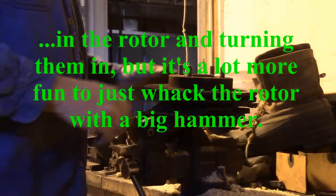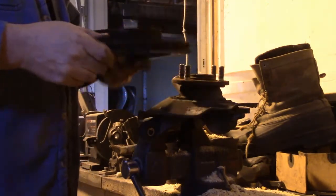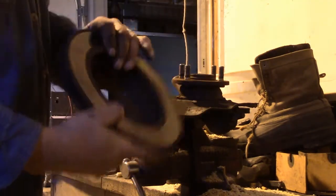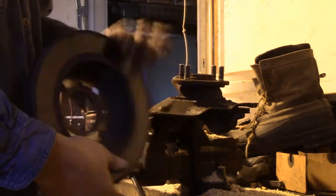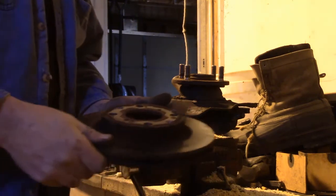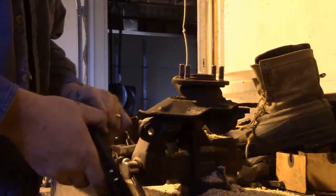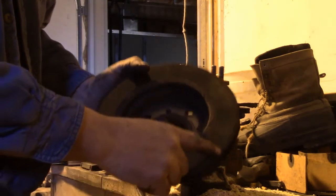You can tell by the change in tone when you whack it — once it comes loose, the ring changes. There's my rotor, and it's actually in fairly nice shape. We got this done before the brake pads were worn all the way down and ruined it. We do have a certain amount of buildup — it should probably be cleaned all the way to the edge.